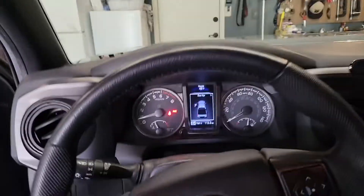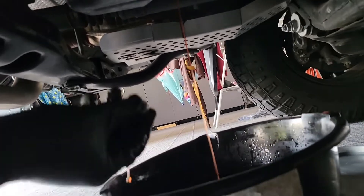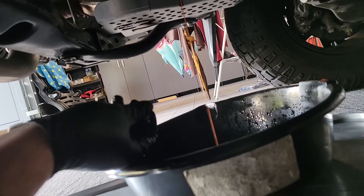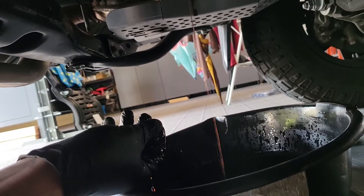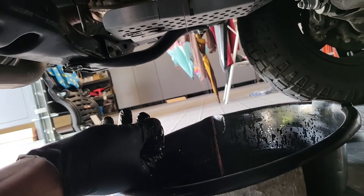The D just popped up because my truck was already warm, so I've got to go check it right now. I just pulled the overflow plug — this little 5mm hex — and see how it's pouring out of there? It came out pretty fast when I pulled the plug. When it goes down to a dribble, you know the transmission fluid is at the correct level.